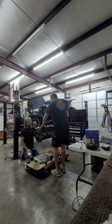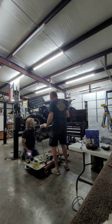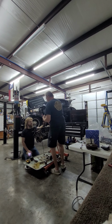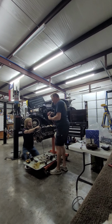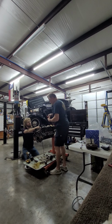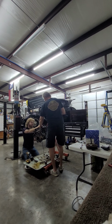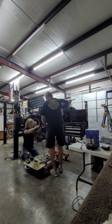Do you see the thing about the not full counterweighted? Very nice bearing. So you think these haven't even been loaded down enough? The other thing you can do is look at the back side of a bearing. If it doesn't show any heat, it means it's in really good shape. But this is not the load side. This is the load side in one way. At higher RPM, that's the load side. But in a grandma car, that ain't ever gonna see that load. Nothing worth talking about, anyways.